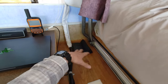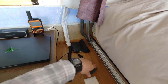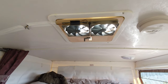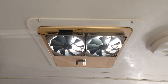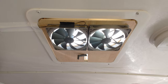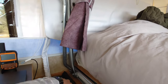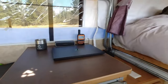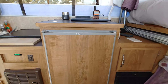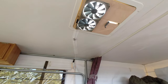Above that, I just have a little cubby hole full of things. This USB and battery bank runs the fans I put up in the ceiling — this camper did not come with any fans, just a vent. Rather than getting a Fantastic Fan or MaxAir fan, I took two 12-volt computer fans, screwed those into a board, Velcro'd those up there, and spliced the wires to a USB. This takes 5-volt USB power from the battery bank and turns it into 12 volts to power those fans — that moves just enough air to keep the camper from getting hot while being very power-efficient.